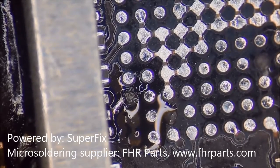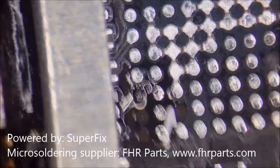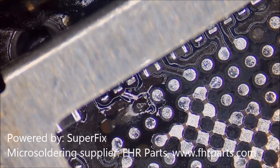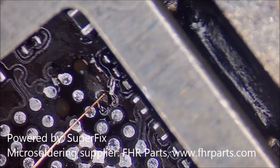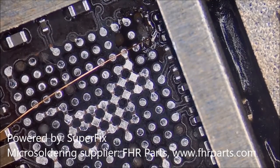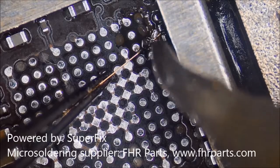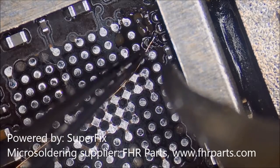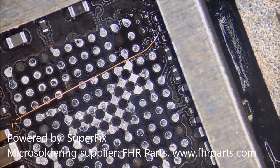Even Apple did a recall on the iPhone 6 Plus. We use a blade to scrape up the surface of the motherboard and level the circuit. On the circuit, we apply tin — it helps when we are doing the first end of the micro jump wire. We hold this wire using tweezers on the left and simply solder it onto the circuit. The point is to only tip the micro jump wire instead of applying it entirely onto the motherboard. You might have to try this several times because the wire is very thin.